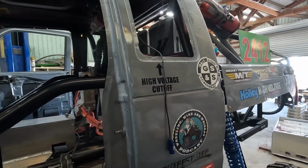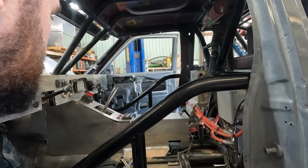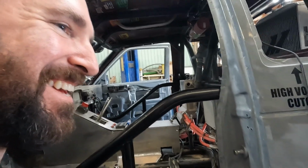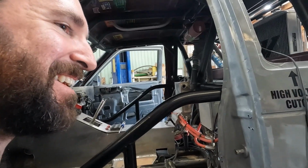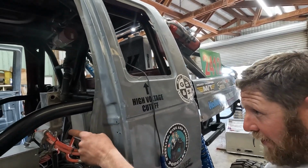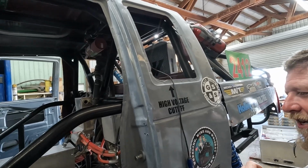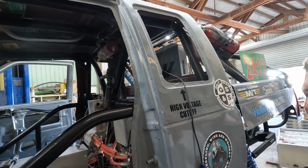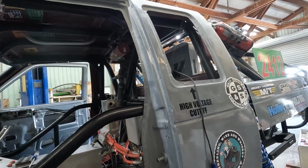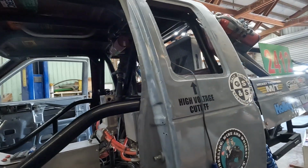So what about this stuff in here? So that's your transfer cases. I've driven trucks before, and they have one transfer case. A standard vehicle has one transfer case. For our application, we have a high-low transfer case gearbox, which is the far lever on her side. The lever closest to you can unlock and lock the front axle, and the middle lever unlocks and locks the rear axle. So I can make this front-wheel drive or just rear-wheel drive, and then lock them both in. Wow. So I have options.